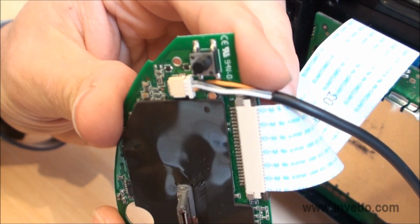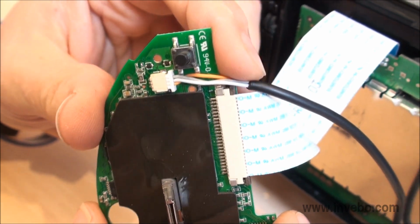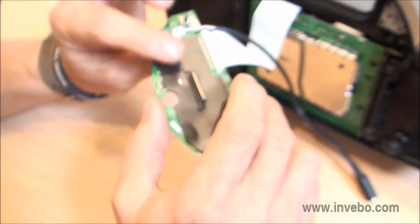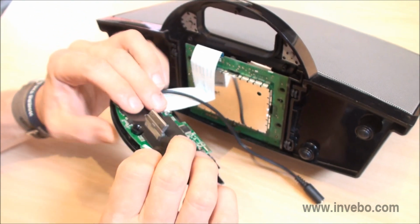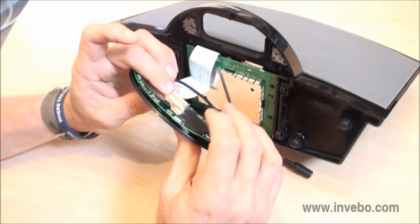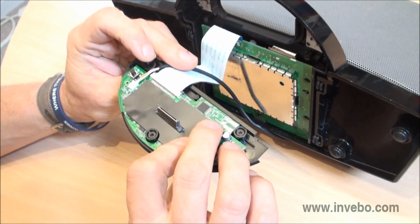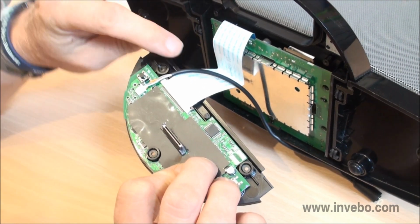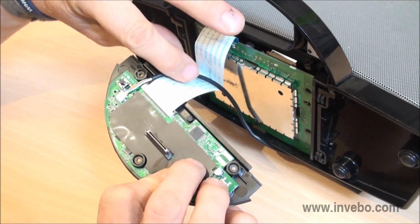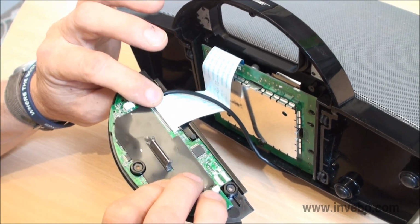So that's the connector fitted into the BC6. Right, the next stage is to put the moulding back onto the BC6 board. Make sure it's down over the pegs as instructed, and we're going to route this cable just to the left of the ribbon cable and the upright pillar. If you have it like this and you put the screw back in, then the cable will be trapped between there and that pillar, but to have it just there is absolutely fine.